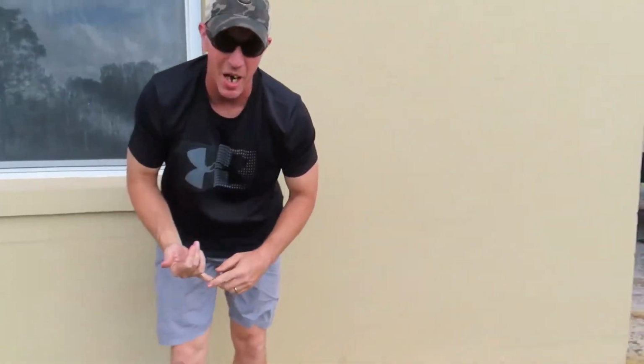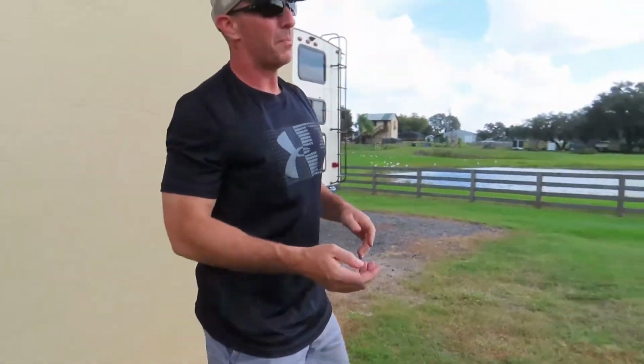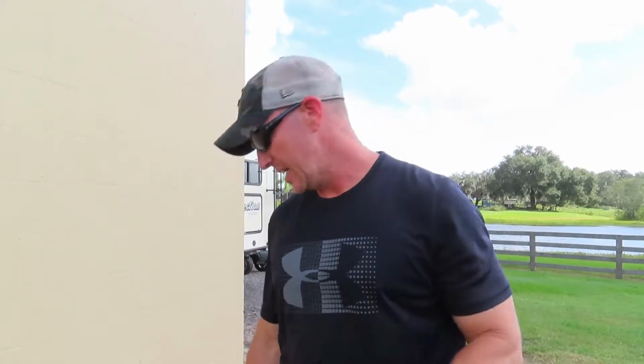It's going to be the cheapest option, but it's not necessarily the best option. Flooded batteries are great, number one, because they are low cost, but they do require maintenance. Anytime you're going to put them in a deep cycle application where you're drawing them down and recharging them, they're going to use water. There's no way around it, and I don't care if it's a maintenance-free battery.